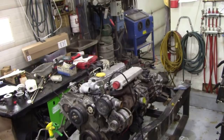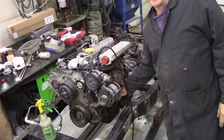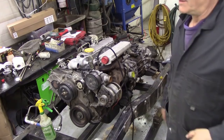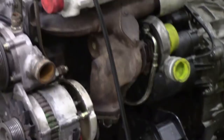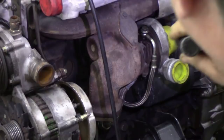We'll put the cap on and it should stop, but it's not — it's getting lower now. Remember I said I've got the manifold on. I've actually blanked off the exhaust — I've made a plate here with a rubber gasket so it blanks off there, but there's still a bit of a leak. One of the places it's leaking — and you can see a little puff of smoke now and again — is the wastegate actuator. It's behind the manifold here, very hard to pick up.